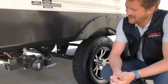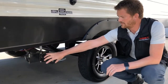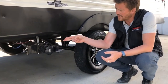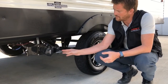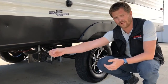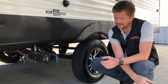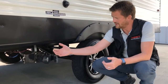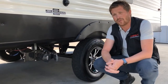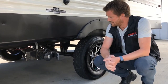Here at the plumbing termination, this is where you'll hook up that sewer hose — hook one end onto here, the other end goes into the ground. You have two valves: a larger black sewer valve and a smaller grey water valve. Always dump your black tank first. Once the contents of the black tank have run through the hose and you can hear it's not draining anymore, close that valve. Then open the grey valve to use your sink and shower water to flush out the sewer hose for a more pleasant removal.